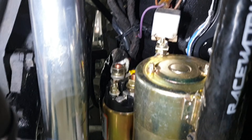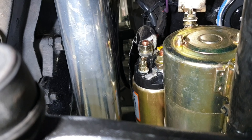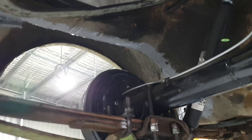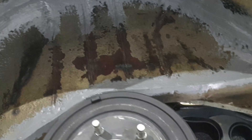I've got it all wrapped up there, hooked up where the brake pipe goes, comes down under here, P-clipped and zip tied to the brake line and the fuel pump wiring. P-clip there, comes across here, then I've got the Raceworks heat shielding over it running up past the transmission and up the back of the block onto the starter motor. Plenty of gap between the extractors — with that Raceworks heat shielding it'll be fine. Battery's all in. Just waiting for Rick to come back tomorrow.